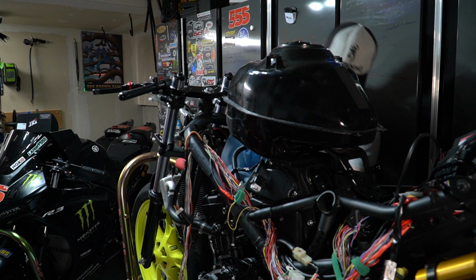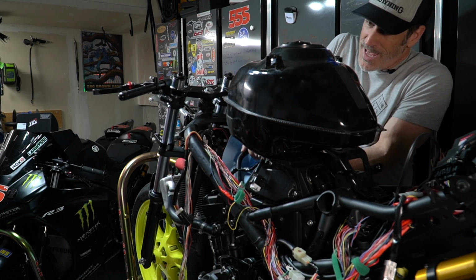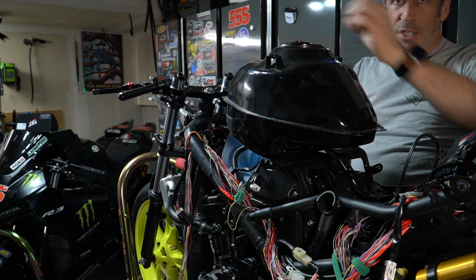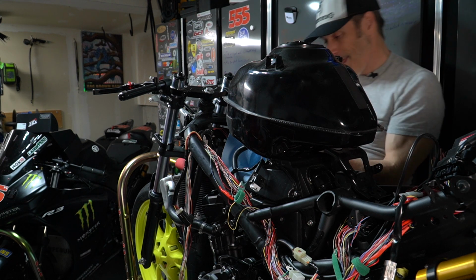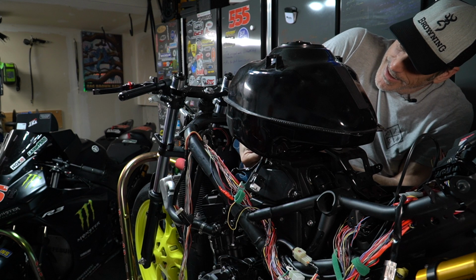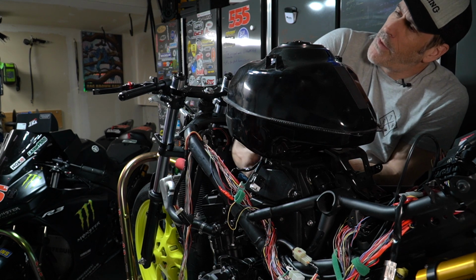And the fuel line that's connected to the fuel pump is on the other side. So I'm just going to navigate on this side here, and same thing here for this one. It's a bit trickier. You have to push a brown tab out of the way. And even though I've done this a million times, it's always a bit challenging. So what you want is push the brown tab away, or the brown clip away, and after that press on the tabs. And you might have to wiggle that hose around a little bit, and then you can press on both sides, on both tabs, and pull towards the front of the bike.